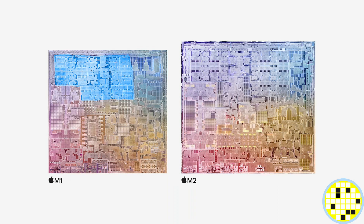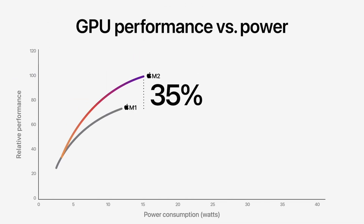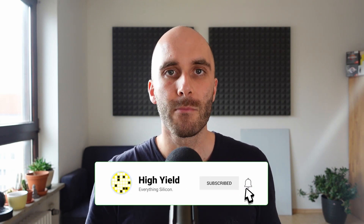The M1 GPU with its 8 cores is pretty easy to spot on the M1 die shot, and it looks like Apple really just added two more cores to the M2 GPU. Going from 8 to 10 cores is a 25% increase, and that's also exactly the performance number Apple provides when both chips are running at the same power, while the 35% performance uplift was achieved at a higher power draw. So 25% more GPU cores result in 25% more performance. These claims from Apple are a direct translation of what we can see on the silicon itself. But 25% more performance at the same power also means Apple achieved a higher efficiency — the question is how they achieved it. You can get better efficiency by creating a more efficient GPU IP, but I think the GPU on the M1 and the M2 are pretty much the same.